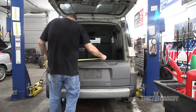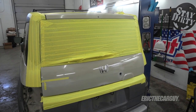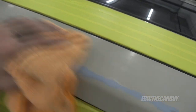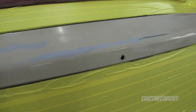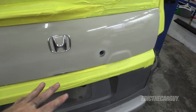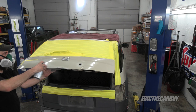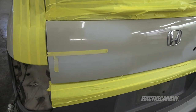Let's do some masking. Now that I have everything masked off — I could have used paper or plastic so I didn't have to use so much tape, but oh well. Now that it's all masked, I can prep for paint. To do that, I wiped everything down with a microfiber towel and then went back with prep spray, sprayed it on, and let it dry. Next step is to add a little bit of spot primer in these areas — I'm going to use that as sort of a really thin coat of body filler. I can wet sand against that, smooth things out real nice, then add the finished coat, then the clear. I'll let that first coat dry for a minute, come back and add another one, then do some wet sanding.